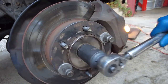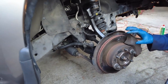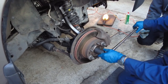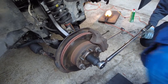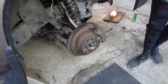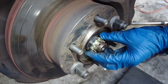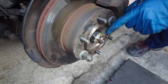We're now going to torque the CV axle nut to 174 foot-pounds. The way we'll hold it steady is to have Scott inside the rig with his foot on the brake, clamping onto the rotor, while Liam uses a big half-inch drive torque wrench. We torqued it successfully. Next we get a new big cotter pin in place — don't reuse the old one.